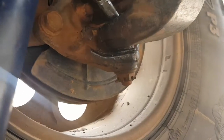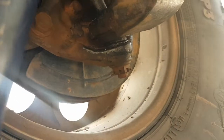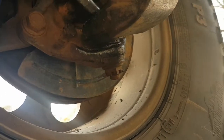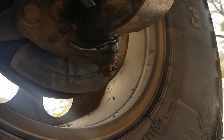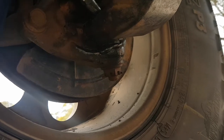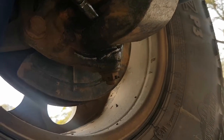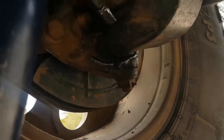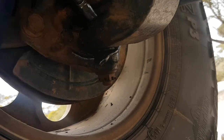Something to remember about greasing, guys, is that grease is not just there to provide lubrication. It's also there to drive out any contaminants. Any diesel fitter or a farmer or anyone who works with earth moving equipment will tell you how good at doing that it is. You can see that bad grease just getting forced out there of that ball joint.